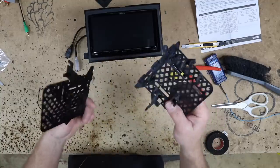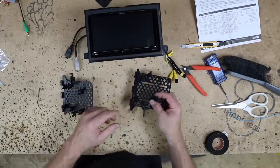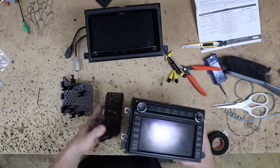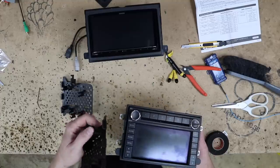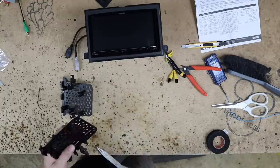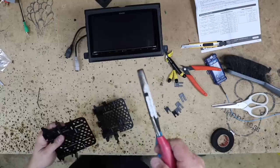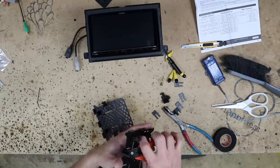These are the brackets for this dash kit. There are a lot of brackets depending on what you're going to do — your best bet is just grab the factory radio and match up to see which ones you need. In this case it's just going to be the front guys. That means we're going to break off the rest. I like to use duck bill pliers — they just have a flat head — and flush cutters come in at the end and do a really nice job. These will just snap into place.